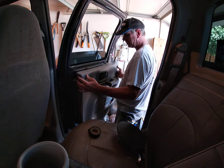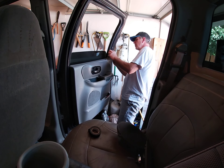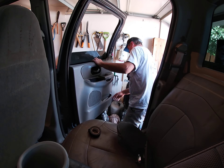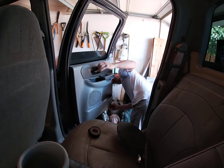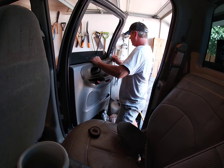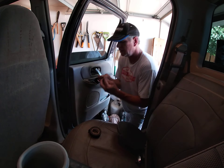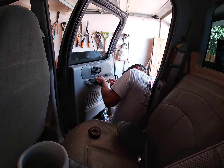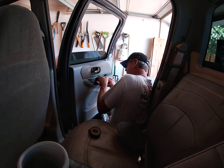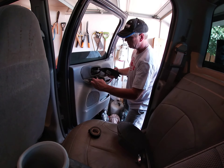Going from the top — same way as you took it off. You'll see your lock go on. Make sure you're seated right here — that's good. Going to throw in the seven thirty-seconds screw first, right here just to the front side of the door handle. Put the switches back on.